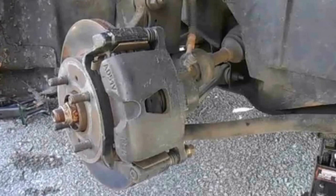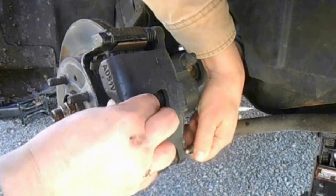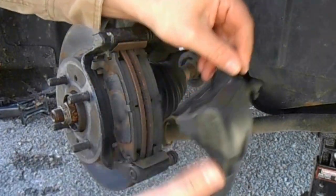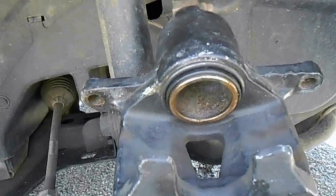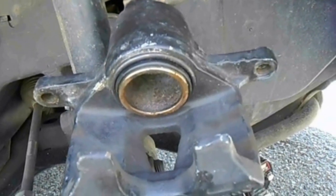This is our project one year later. Performance has been very good and it's showing no signs of trouble. The slide pins pull out easily by hand. Before, the brakes were rock hard and noisy due to bad calipers and rusted brackets. But with the rebuilt units, braking is a lot smoother and more quiet. We have no leaks around the dust boot and I'm getting even pressure on both sides of the rotor.